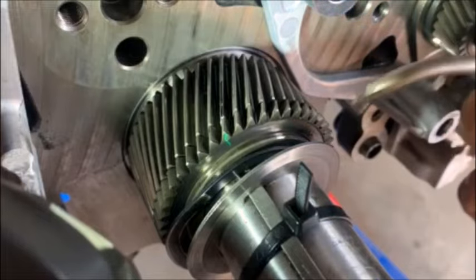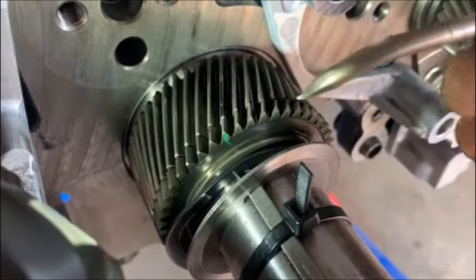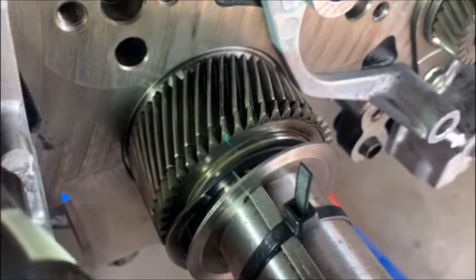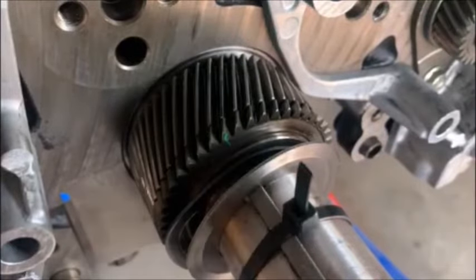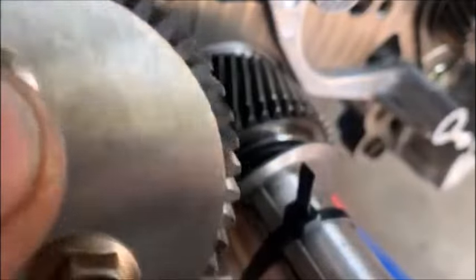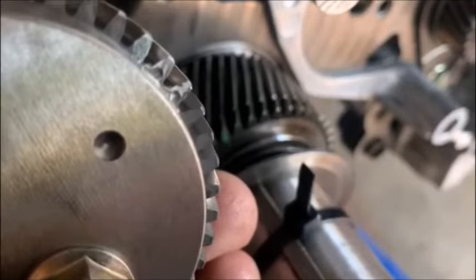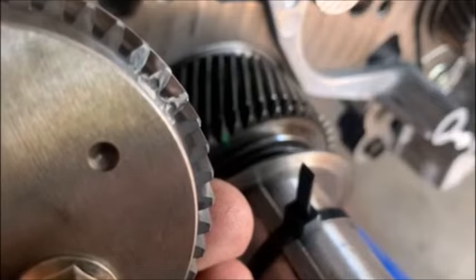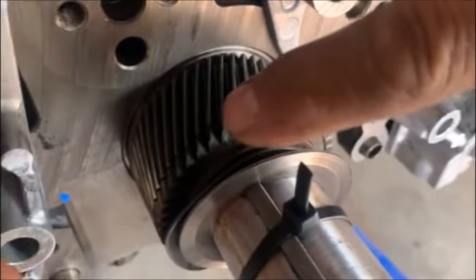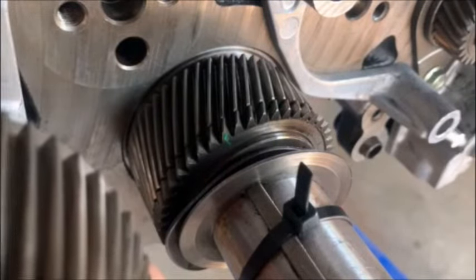Further down there — I'll change the camera — there's a gear that's also a tooth that's marked like that. The trick is to get this idler: this idler has got a tooth that's got a single mark there, and it's got a double mark there. So that double mark must go over that single mark, and I'll put that in quickly and show you. There's a trick also to see — I'll change the camera and show you.